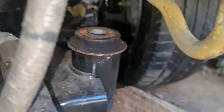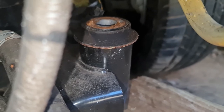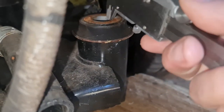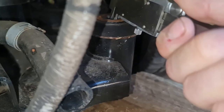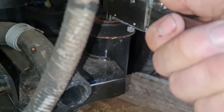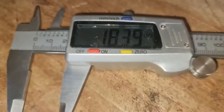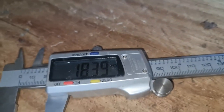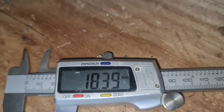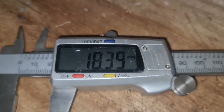Next thing I need to know is the hole size for the K-frame. I know they're an 18mm head on an M12 bolt, but I just want to check. That's actually an 18mm hole, so there is a lot of slack in there. I know I pulled a 12mm shaft bolt out of it. So I will be putting 18mm holes into my plate.